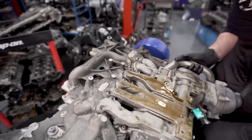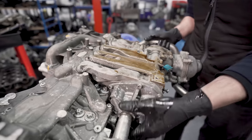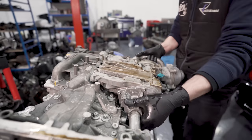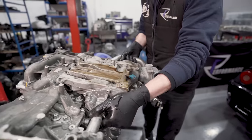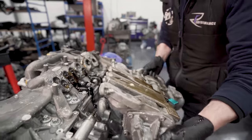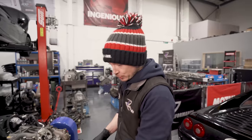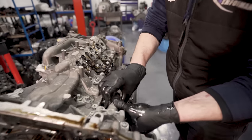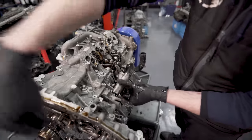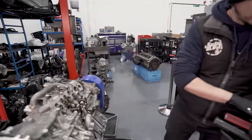So when the oil pump's going in, there you go, you can see it starting to go, look. So we've got to come off the dowels, right? Like so. And then we've got to come towards me because it's engaged on a water pipe, which is what's creeping. So this is the oil pump drive shaft seal cover, or oil pump drive shaft cover. That's a tube that when I pulled the auxiliary drive out, that long drive shaft came out. Yeah. That's fine.